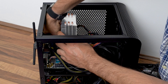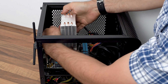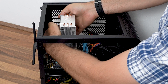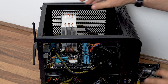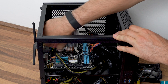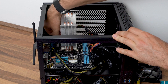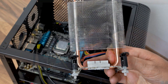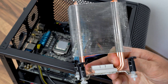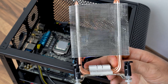Let's get this heatsink out of the machine. You can see me here fighting with those little clips. This last one on the back is a perfect example — if it was a screw mount I'd be able to get a screwdriver down and just undo it, lift the heatsink out, no problem at all. Because it's in an awkward place it was very fiddly to get that last one undone. But that's all four of them now undone. As you can see there's a bit of dust on this heatsink but not a lot — you can still see through most of the grills.